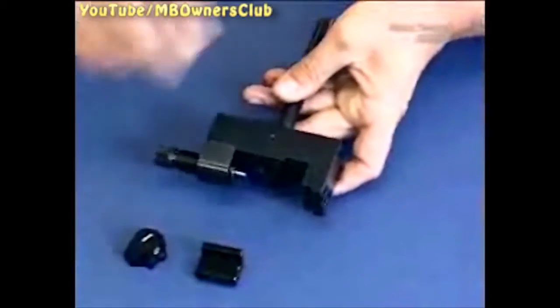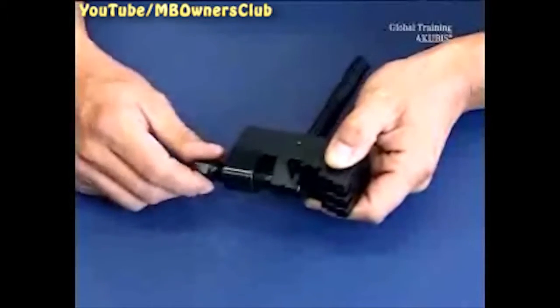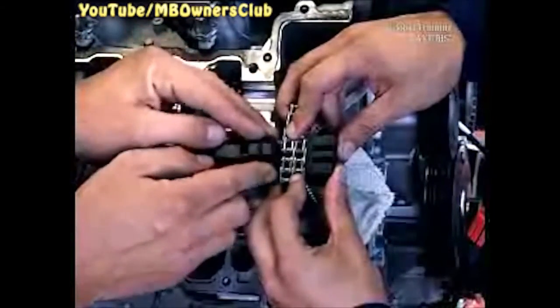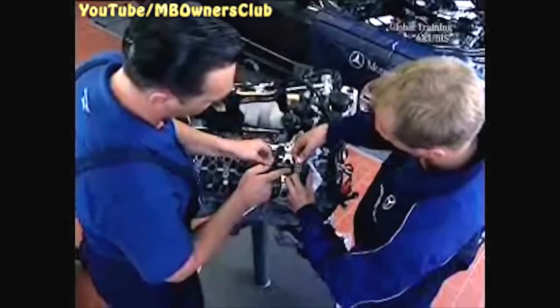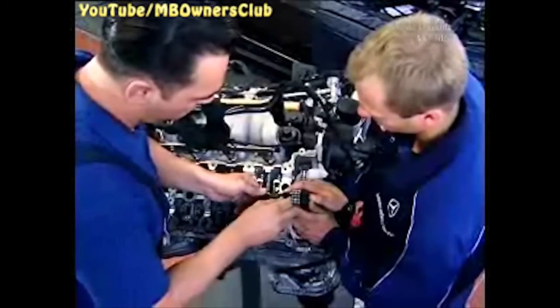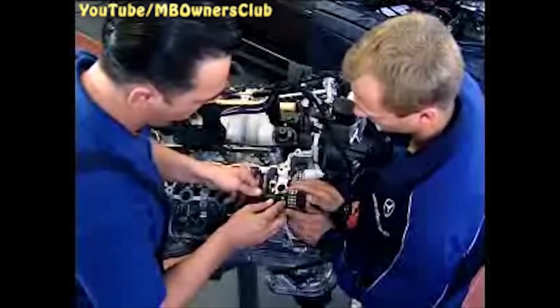For this, install the press rivet assembly kit 2. Put on the tool. The magnet holds the outer retaining plate in place. There are spaces in the timing chain — the link and the outer retaining plate align. Then turn the handle until firm resistance is felt. Now for the final riveting step. Turn the mounting assembly over so the magnet is facing upwards. Now turn the pressure handle again. The reference value is 32 newton meters.